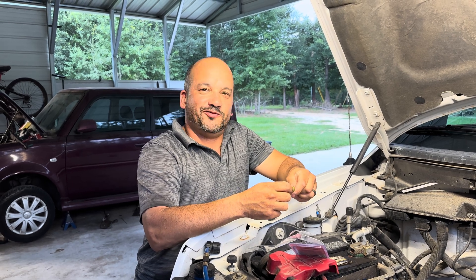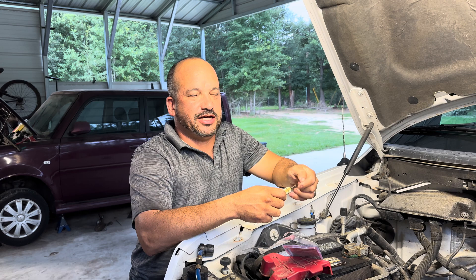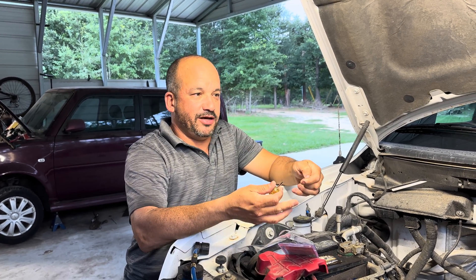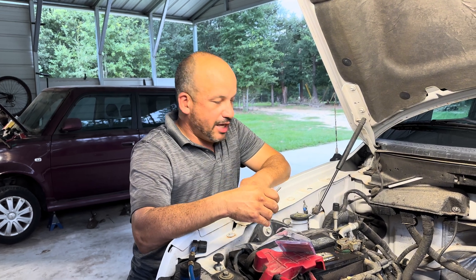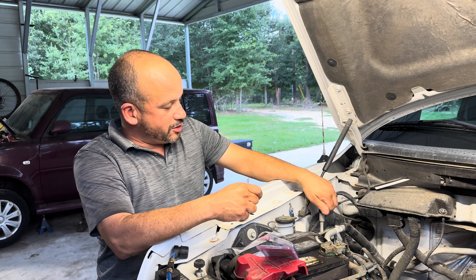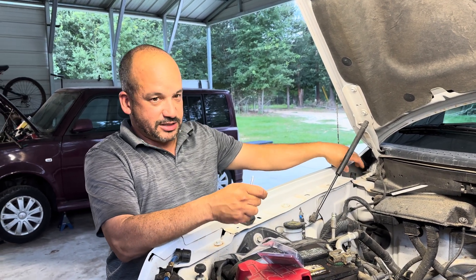This is my wife's truck. It's a 2012 Ford F-150 and the AC has not been cooling. I know it's low, so I've already evacuated the R134A that was in there. I know it was leaking from the high service port, so you only want to do this when everything's out of there.